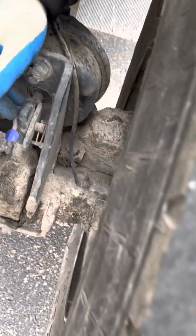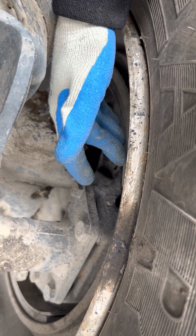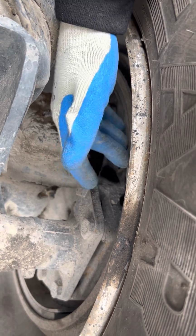Then on the inside here, I have my brake linings. Make sure my brake linings are not bent, broken, or cracked, properly mounted and secured. I'm looking for 3 things. Make sure there's no signs of heat stress, not worn dangerously thin, less than 1/4 of an inch, and no fluids on them.